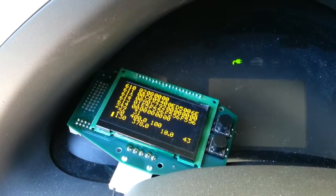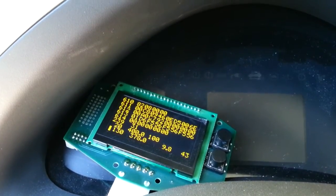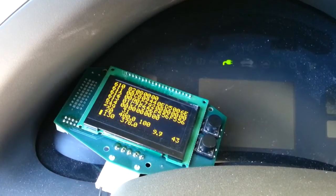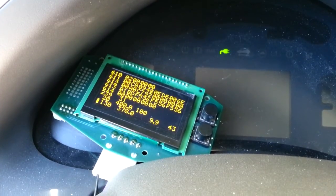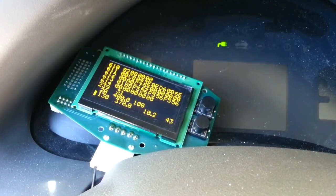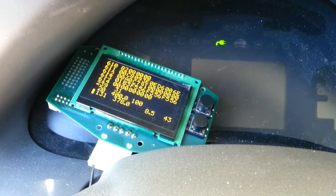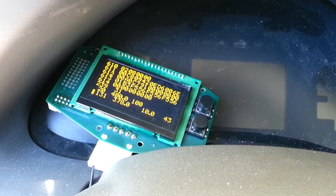Greg may implement a few more tweaks we've been talking about, but for right now this is working beautifully. I ran the wiring through the firewall so it looks nice and tidy. I know Jeremy and a few others want to tap off right underneath the front plate, but my concern is making it watertight — you'd need to add another cable gland up front. The way I've designed the plate, I can get everything off in under 15 minutes and the car is completely stock. If you tie into the CAN high and low lines up front, Nissan could complain about hacked connections. This just plugs into the OBD port — pull it out and the car is completely stock, nothing done.